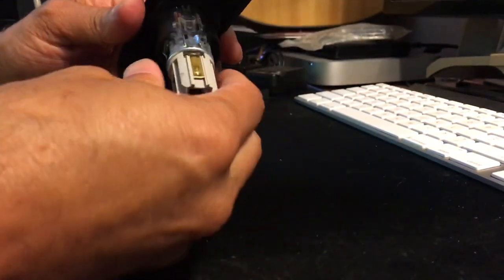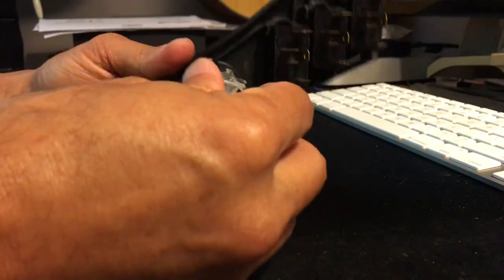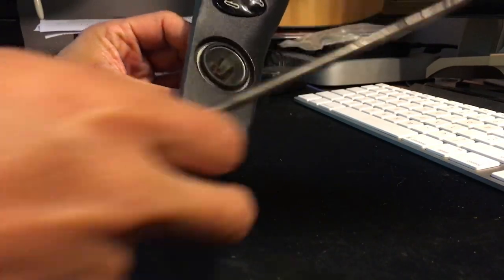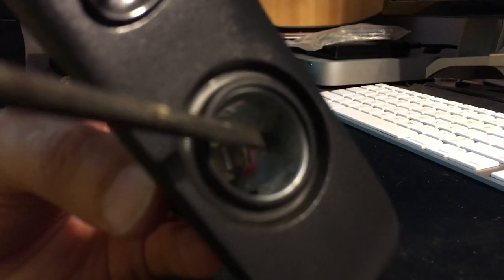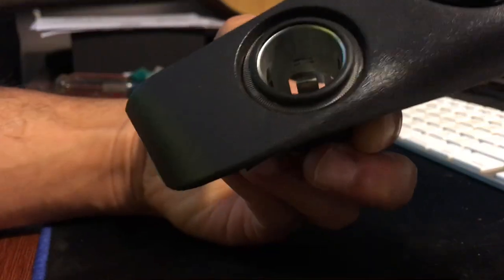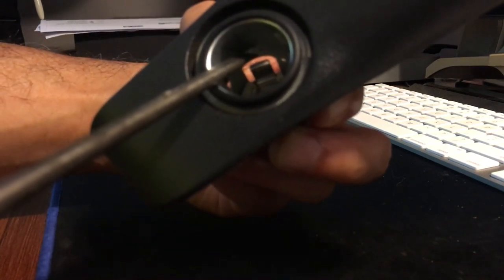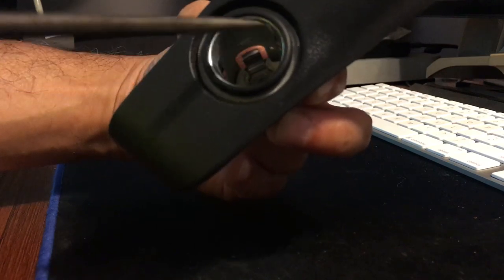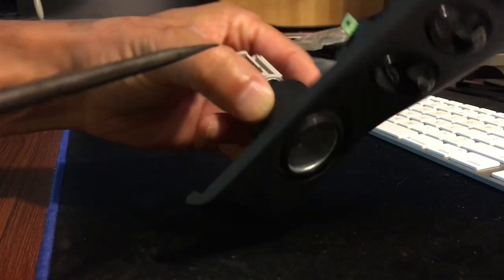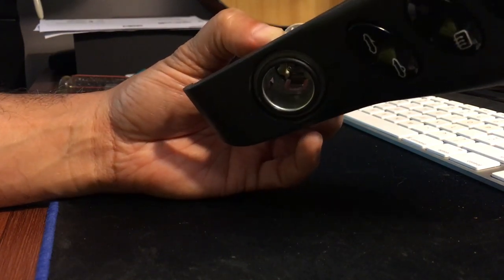Now let's see what we're dealing with. We've just got the cigarette lighter and then the clear housing — these are two different parts. On the inside there are these cutouts where the clear wings from the outside are kind of snapped in. So what I have to do on this side here, and then again on the opposite side, is separate those and push them away from one another — to the outside. That should free the clear plastic ring from the inside lighter. As we push that apart, we should be able to press this through and it should just pop through.